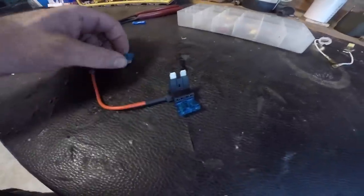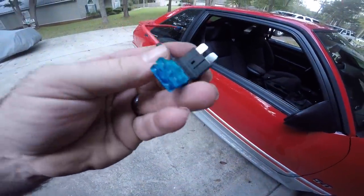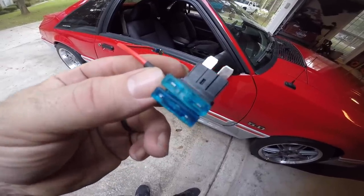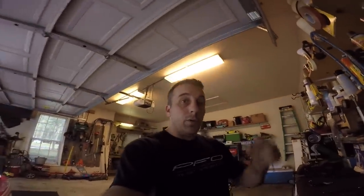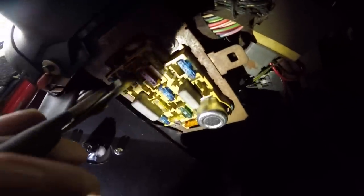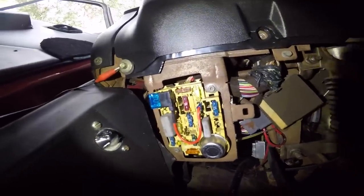Once you get your connector on, all you have to do is add one more fuse. The reason you're adding another fuse is because you're not only carrying whatever is already on that circuit — you now have to carry the fog lights too. The regular fog lights are rated for 15 amps, so it's safe to put a 15-amp fuse in here; you could probably get away with a 10 also. Now we pull out the circuit we want to pull from, plug in the new circuit — and let's see if we can get these fog lights to come on. You want to pull out an always-hot circuit and put your new circuit in. Nice and neat — I love that it's so simple.